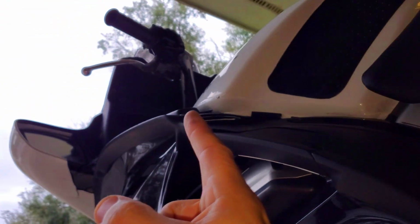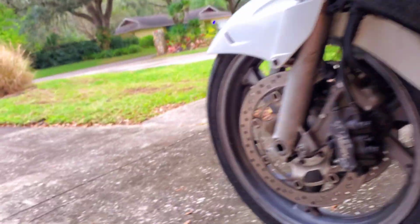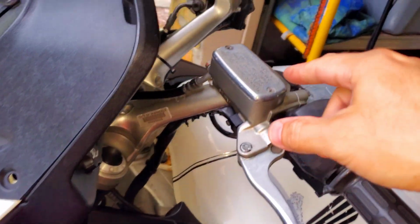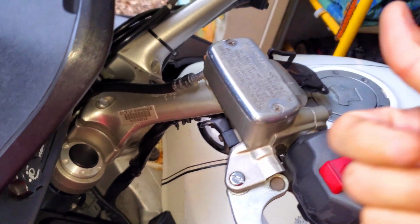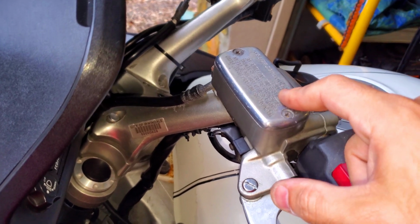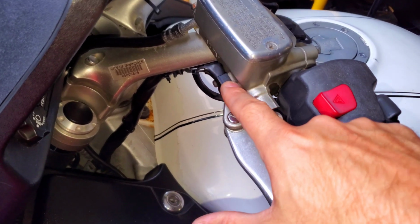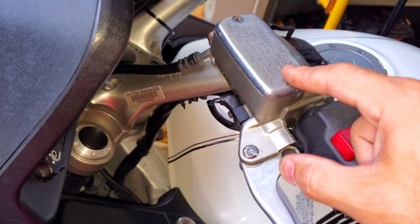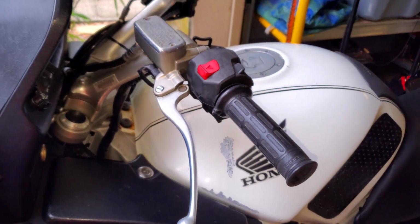You're going to take off the top of the master cylinder up there, so that you can pour fresh fluid in, right? And an easy thing you can do, which I'm going to do next after I finish removing this, is I'm going to pull 90% of the fluid that's in here out before we even get started, because that'll really speed up the job. I see a lot of people just keep going like this until all the fluid gets down, and then they're just now starting the draining process. What I'm going to do is remove whatever's in here first, just before it creates an air pocket, and then I'm going to refill it with fresh stuff. So I'm going to go get my syringe, and I'll see you guys in a sec.